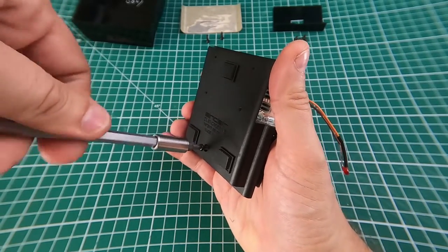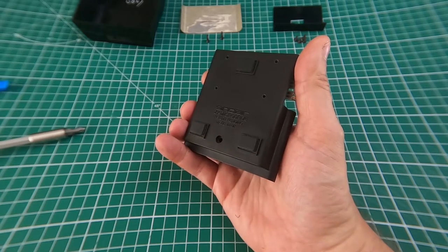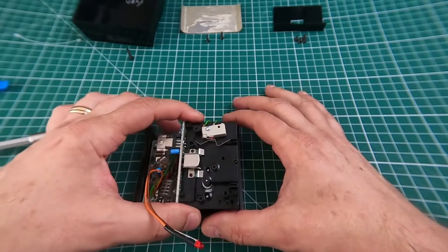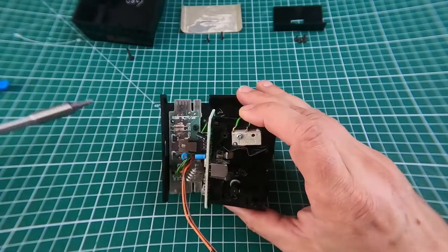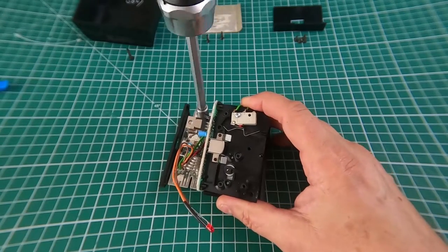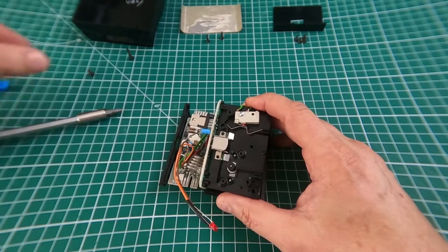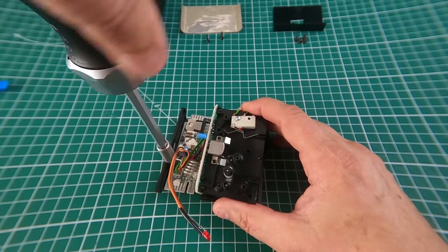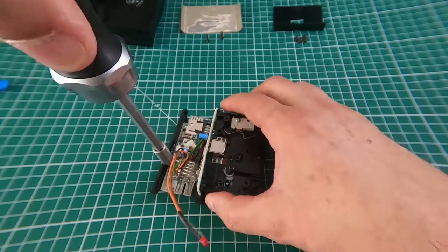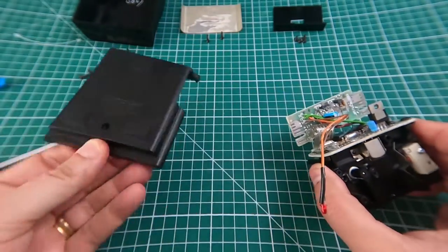That's quite a long screw — it's not officially Pozidrive, but Pozidrive obviously works. Put that there. What that does is release this main bit here with the motor on it, meaning you can lift that up and get access to the screw underneath. Take that one out and put it to one side. Then get that next one out as well, and with that one out we can take the whole mechanism out. Put that aside — that's the base plate removed and now you've got access to the underside. That's the whole interior taken out.